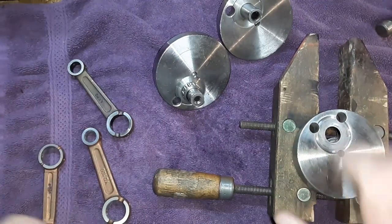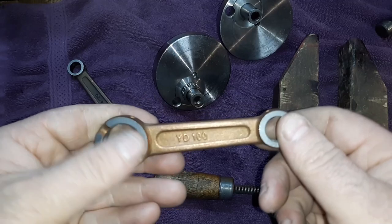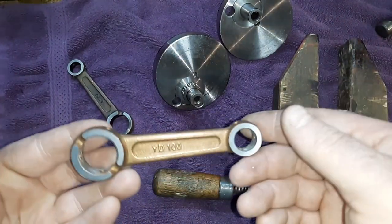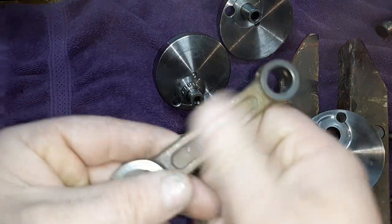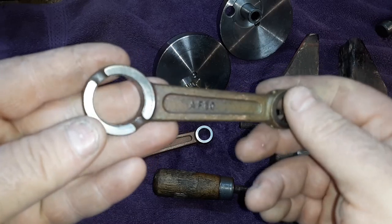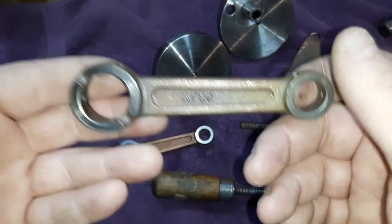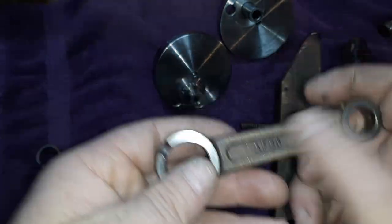So there's this big misconception that you buy a YD-100 and it's 40 millimeters — chances are it's probably a 40 millimeter stroke, but it does not mean it is. Here's an AF-80. People are like, 'I bought an AF-80, I got 40 millimeter stroke.' No, that doesn't mean anything. The rod stamp means nothing.